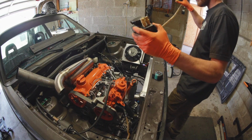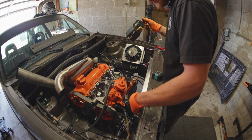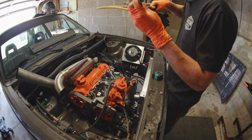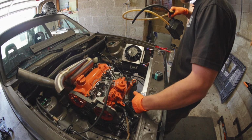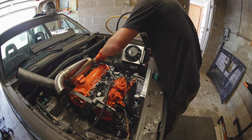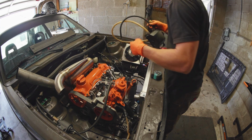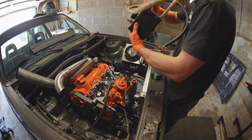So that would leave the only other thing to iron out being the reservoir, which I have here. Currently this is connected to absolutely nothing. That means we need a run of hose of this diameter, which is like, I don't know, 1/8 inch or something, 1/4 inch ID hose, that goes from our radiator overflow back to here, and we also need a hose that goes from the head steam port, which is right here, same size, back to our upper coolant bottle hose.